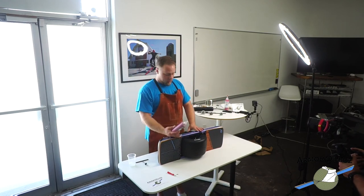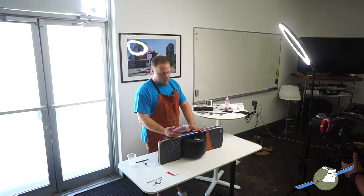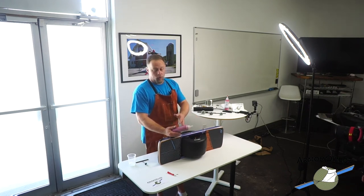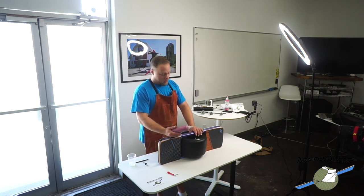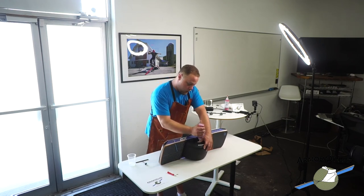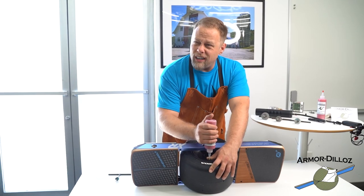Now, the way we install this, for scooter users, since you have such a small tire, it's kind of critical to put the valve stem up at the top so the product can flow away and get air back into the bottle as you do this. On Onewheels and golf carts and other larger tires, even bicycle tires, you can get away with being a little bit more careless, but really the idea here is we want to stick this inside of the valve core, and we're going to do this in squeezes. So we don't try to get it all in at once.